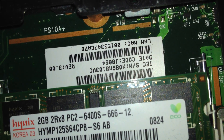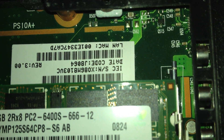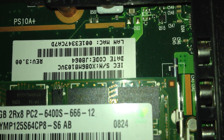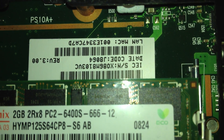This had one, so I went underneath and removed the cover for the RAM. And then, if you can see right there, you'll see a B500 — there's two points — and you go ahead and make a jumper cable out of wire or anything, and short those two connections right there.